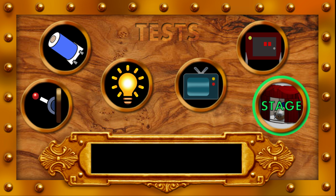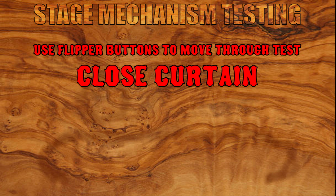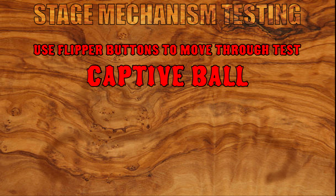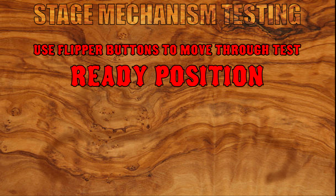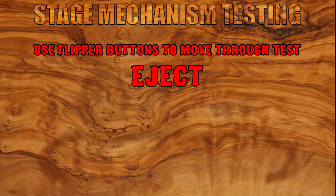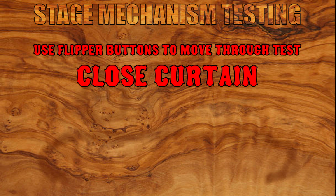Finally, it brings us to the stage test. Using the flipper buttons will let you move through the stage. First, you can open and close the curtain of the stage, and then there's a captive ball inside that moves into different positions. The ready position is when it's able to capture another ball inside the stage, the ability for it to hold the ball, eject the ball, which is a feature not currently in use, as well as then dropping the ball down into the subway. So if the stage is not working correctly, this lets you take it through its various steps.